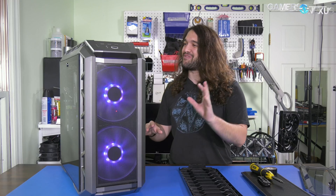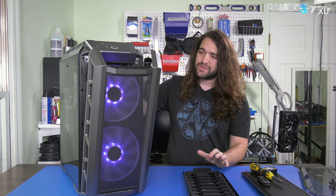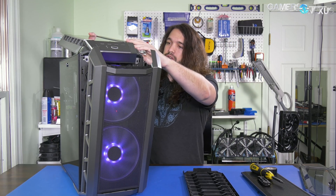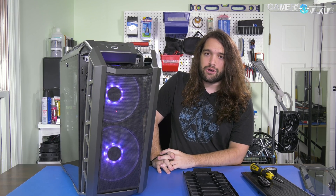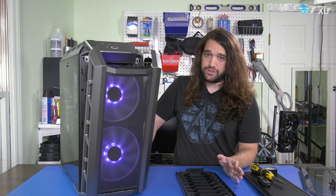So here it is — this is the meshified H500P from us. We're not going to sell it. I think Fractal has rights to that name so it's only loosely named that. The front panel is still the mesh version, tested it all, and basically fixed the thermal problems. The thermal issues that Cooler Master had with the original version of the case have largely been resolved. The top panel we actually restored back to the acrylic panel — there's a reason for that we'll show in the charts. Quick note: the testing here is not comparable to our original review, but is comparable to our radiator testing just posted yesterday. We changed the software for monitoring, the testing method, and the averaging method for the data, improving test resolution.